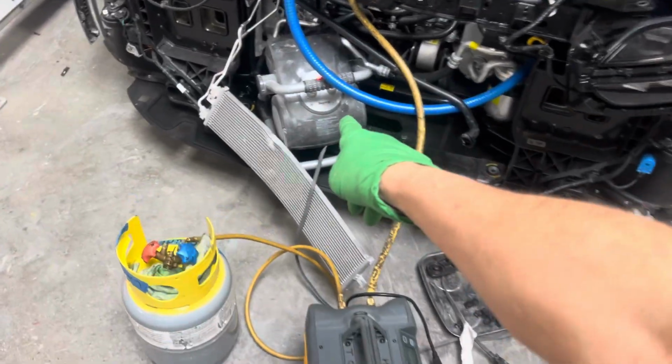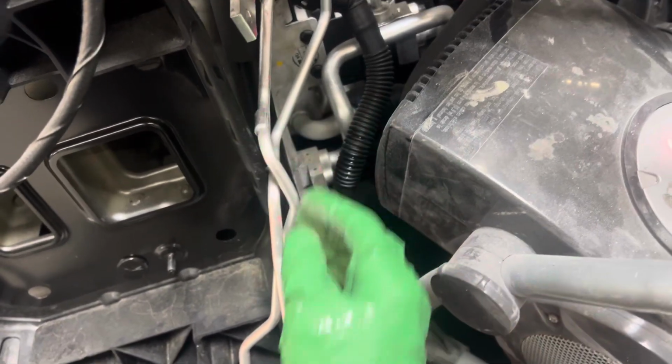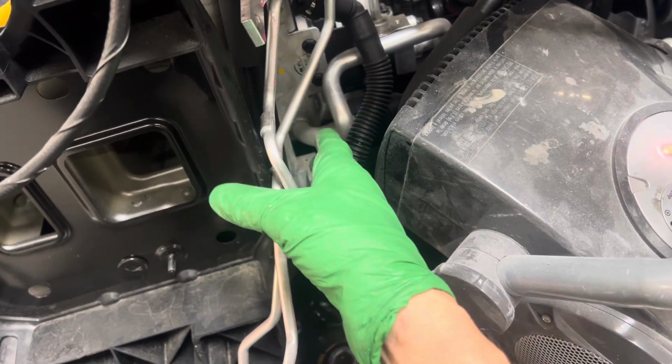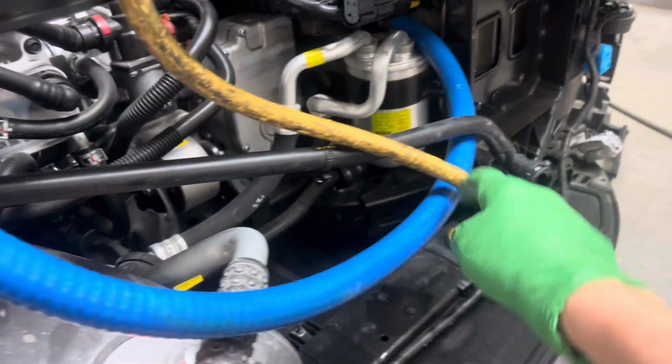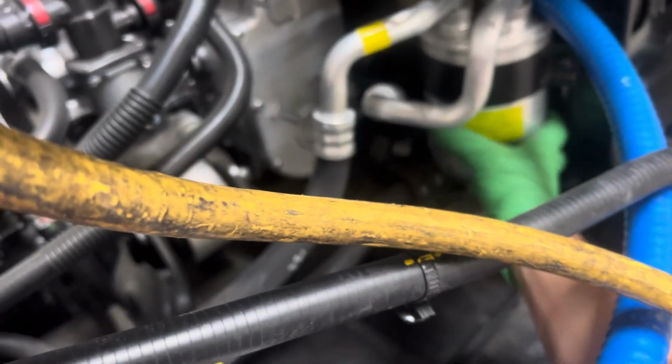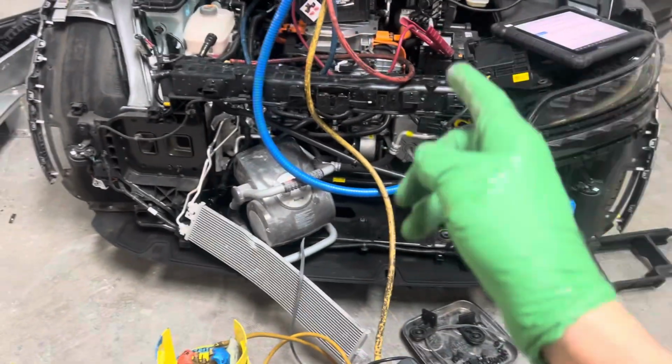Do you notice the heater right here? Because this has water in it and refrigerant, it starts to freeze up and it takes longer to remove the refrigerant out of the system. I also had the heater over here heating up the accumulator. Otherwise, if this was all together, you can't get to this. That is why you're going to charge 2.5 hours to do air conditioning on a heat pump.